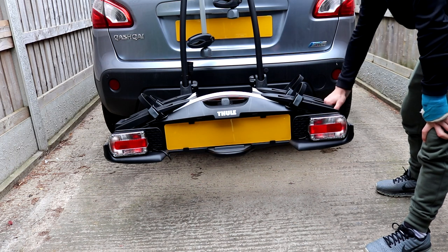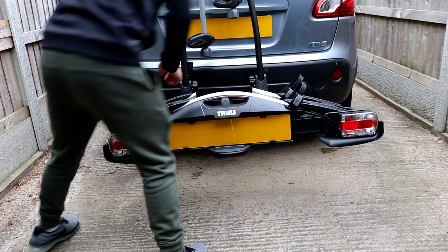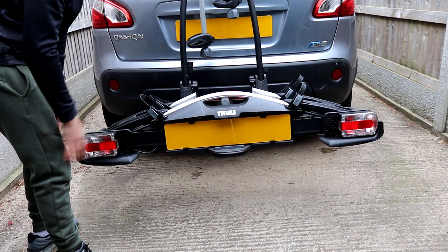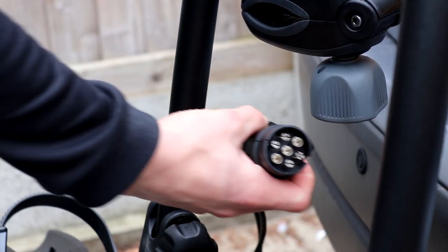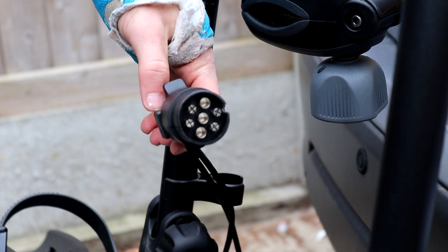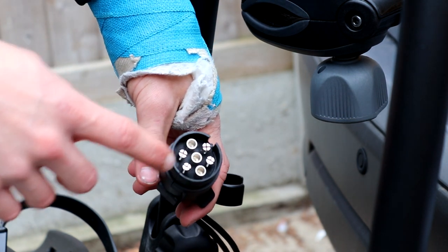The last step to put the bike rack on is to pull out these bits — this is where the wheels will sit on the bike. Pull the lights out and then do the same for the other side. The reason these fold in is because it's a Velo Compact, it's just easy to put into storage, and they fold out so you can put bigger bikes on. Over here this is a 7-pin plug and it basically just goes into the electric plug socket underneath your car so that the lights work on the bike rack. If you have a 13-pin plug then you have to get a 7-pin adapter.